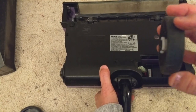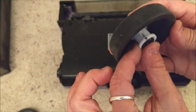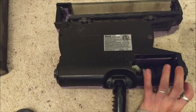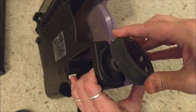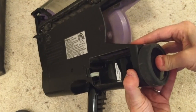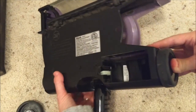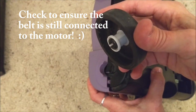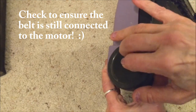Now take a look at the wheel. See how there's a little protrusion — one on each side. I've marked them with a black magic marker line. They need to go right horizontal in between the top and bottom of the case. Make sure the case is open a little bit, put it in so the lines are at the side on each side. You have to push it in hard — real hard — because there's a nub on the top too, so you have to get it over that lip. Do the same thing to the other side. See that line of plastic — put it in, push it in real hard, push down, and then snap the case shut.